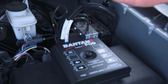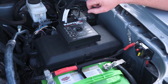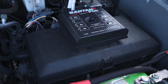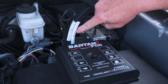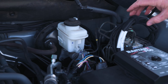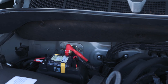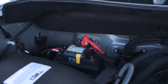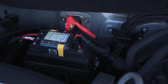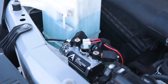This is the Bantam, and we're running the HD panel on the inside of the truck with the rubberized switches. Everything's labeled so you can see where everything is, and that's the same on the switch panel. All of our wire loom — we build all of our wiring harnesses ourselves. Everything's labeled for exactly what it is with heat shrink, run along the firewall, grouped together with Velcro so zip ties don't break, and runs over to the fuse box, which also goes back to the bed where the secondary battery is. Up forward we have the ARB compressor to specifically run the lockers.